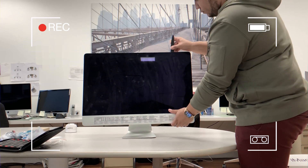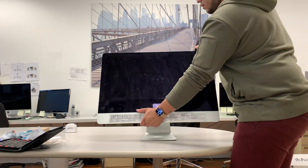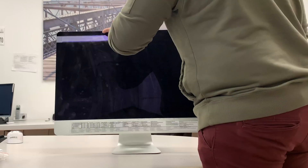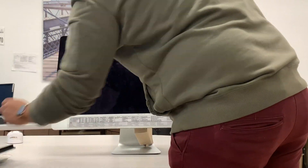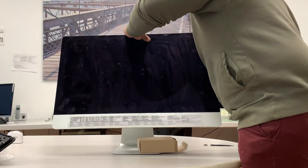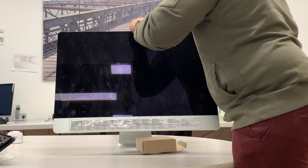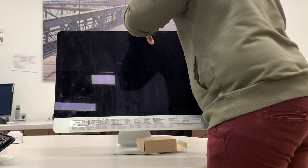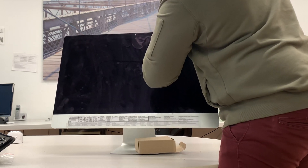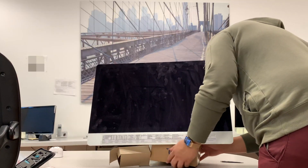We're going to get started and insert the iMac opening tool in between the gap of the display and the rear housing. The iMac opening tool should do most of the job. However, you may need a plastic card to finish cutting the rest of the adhesive. You may lay your iMac flat or keep working upright — however makes you feel more comfortable. You will want to have something holding your iMac tilted back so the display doesn't fall over and rip the cables. You can get something like an iMac foam wedge, or you can get creative and just use a box.